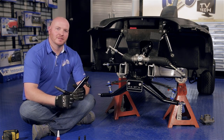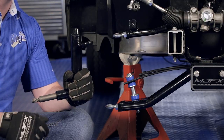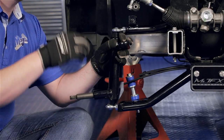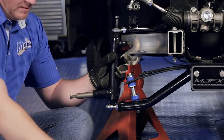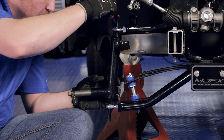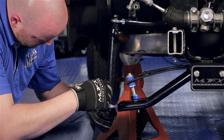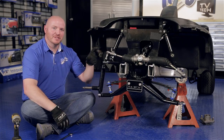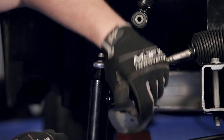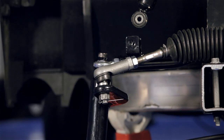We're going to replace our factory spindles with new six inch spindles. This is the passenger side — the tab that mounts the tie rod goes towards the front of the cart. We're going to attach it to the upper A arm and the lower A arm using the supplied bolts. Once both bolts are in place we're going to use our thread locking adhesive and run it around the bolt, then use a three-eighths drive and tighten the hardware. Now we're going to attach our tie rod end to our new spindle using the retained hardware, and then install a new cotter pin.